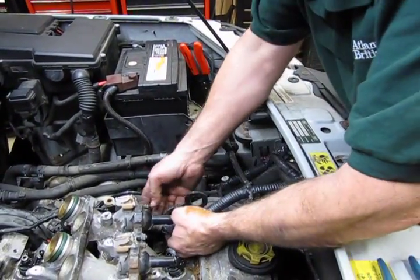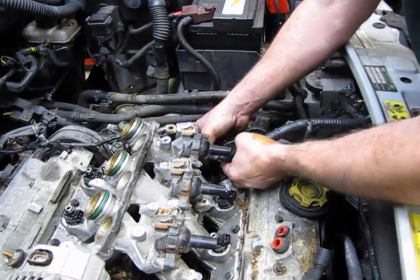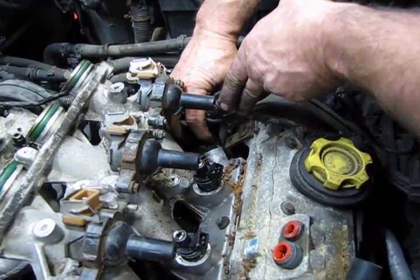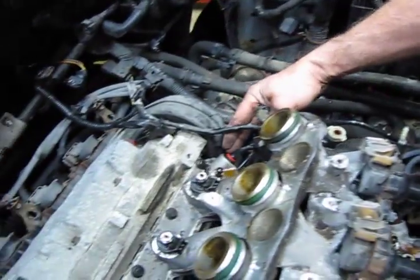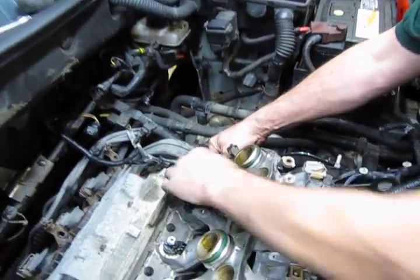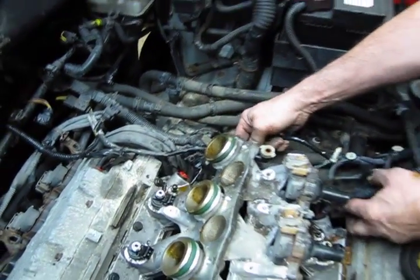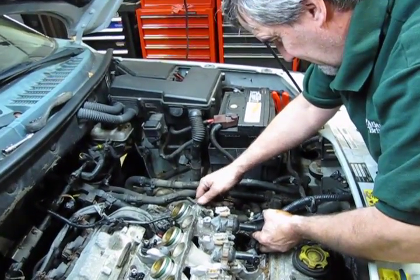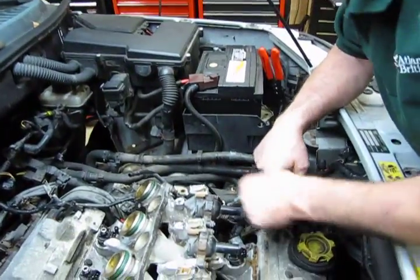Now we've got one more vacuum line just underneath the harness here. You can see there's another quick disconnect red cap there, and the hose crosses back and connects into the lower intake there. So we're going to disconnect it at that point. And then just raise the line just a little bit. Again, be very careful with these lines. As they get older, they get very brittle.